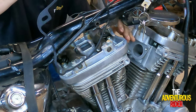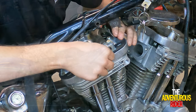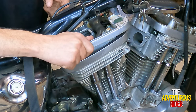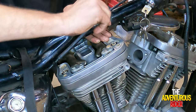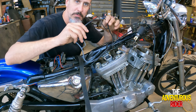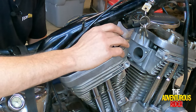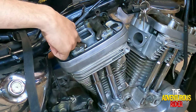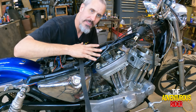We need to put this gasket on — it's got a groove it goes into. Then we'll set our middle rocker cover on. Once we have that on, we need to pull our old flap off — it just pulls right out — and put our new one in. Now that we have the flap on, we can put our upper gasket in. It goes into the groove. Before we put our upper rocker cover on, we need to put this little gasket in the center of the rocker assembly — it's got a little groove it goes into. Now we put our rocker cover on.